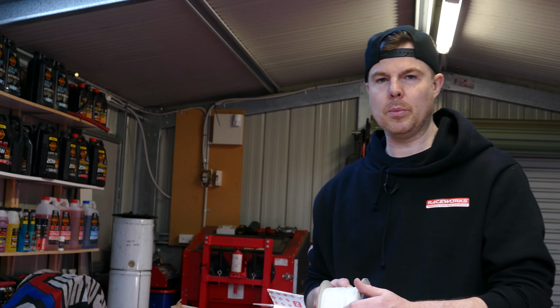So for all your sensors and things like that, these DTM ones are super small. They really work well. They're the ones to go to for small wire, something like your 20 gauge wire. These pins are for something like 16 gauge wire, something that might need a really small thermofan or a really small fuel pump, or an application where you're cutting up a factory loom and the wire's a little bit thicker than your 20 gauge wire. That's the plug to go to.